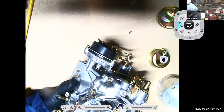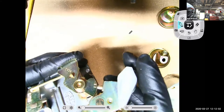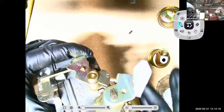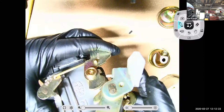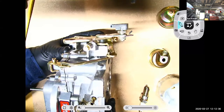The choke system also does one more thing, guys. If I look at the side, what you'll notice is the choke has some linkage here. It locks out the secondaries from operating when I'm running with the choke on. And it also moves over here and it ends up actuating the fast idle cam. So there's an idle speed screw that operates off of this choke fast idle cam. As I take the choke off, then it doesn't touch anything. So that's why your engine will run at a faster speed with the choke on. It actually increases the idle speed to help it run a little smoother and help it not stall out. So you have a separate idle speed screw when the engine's running with the choke on, and that's your fast idle cam and your fast idle speed screw, or your idle speed with the choke on. So your cold idle, if you will.